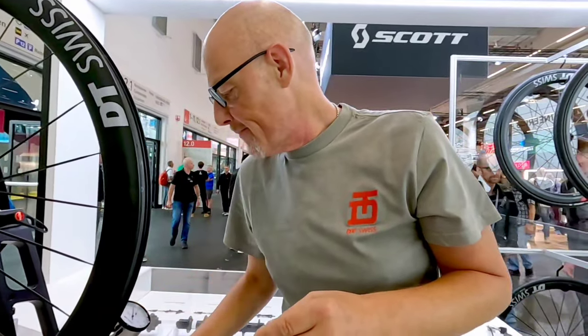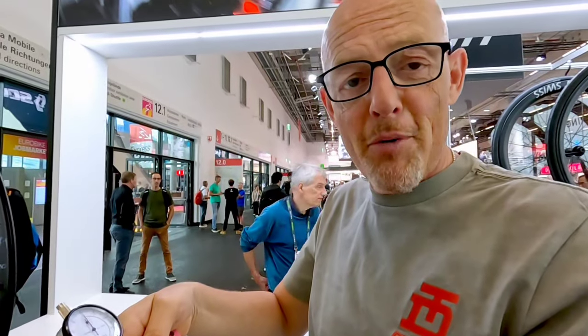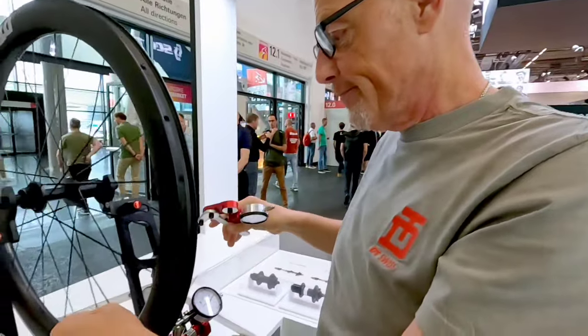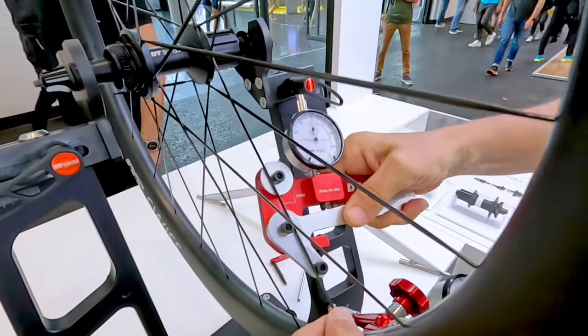The most important thing for our wheels, in our philosophy, is the tension of the spokes — it has to be as equal as possible. When you have equal spoke tension, then you have a long-lasting wheel, because it's like a chain: the weakest part breaks first. The weakest spoke will break first, so we try to have it at a high tension and an equal tension. We spend a lot of time on spoke tension — the tensiometer here is a very important tool, and now I am comparing the spoke tension and looking for where I am too low.